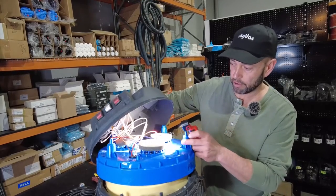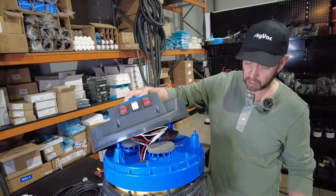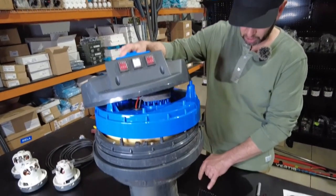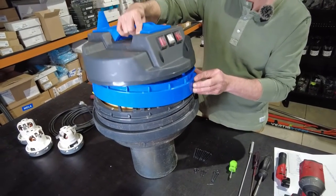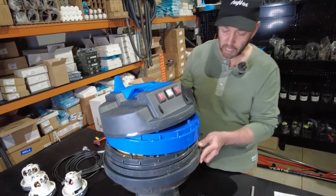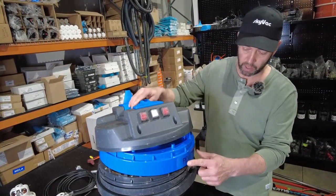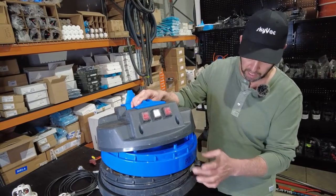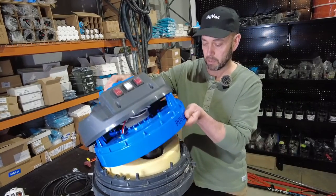So once we break through the first layer, we get on to the next casing. And the next casing is held in by an array of screws, I think 9 screws, all of the same length, which run around the outside. So we'll rip those off as well. Do take note of the power mix lever. When we go to reassemble, we want the power mix sticker above the power mix lever. So that's one tip and trick.